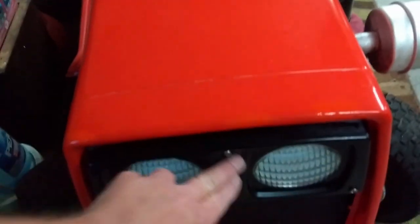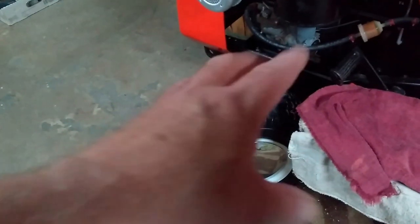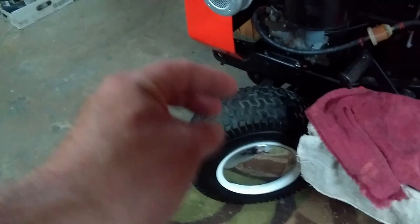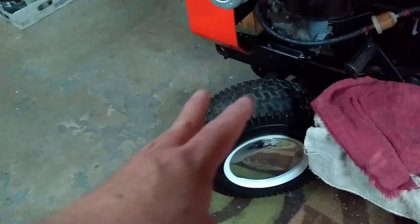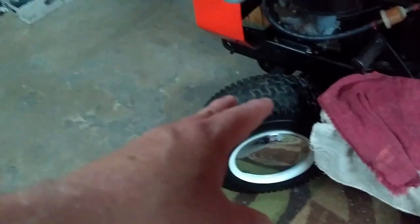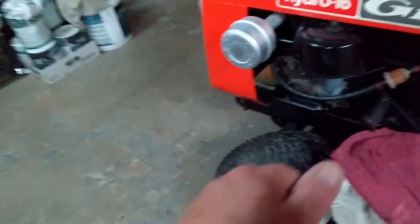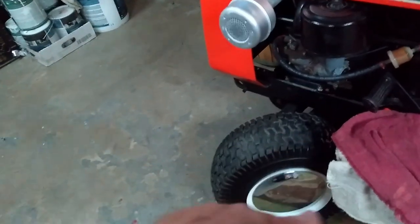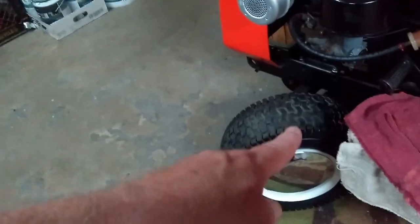I touched up a few spots and fixed this tire. Two days now and she's holding. I took the tire completely off, cleaned up the rim, painted it with an epoxy appliance paint, and let that dry for about three days to make sure it was solid. Then put it back on with an inner tube. Thanks to a tip I found on YouTube about using vice grips when putting that last sidewall on to hold it in place while you go around with the spoons — worked like a charm.